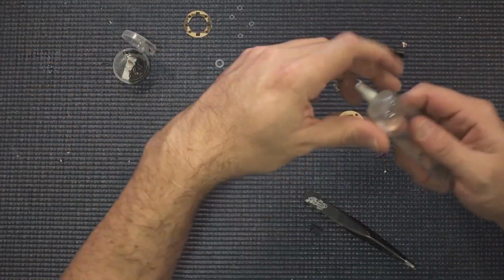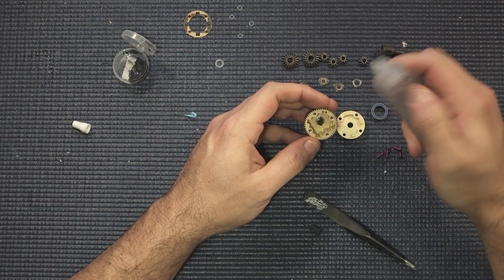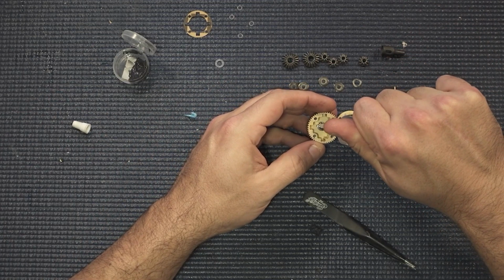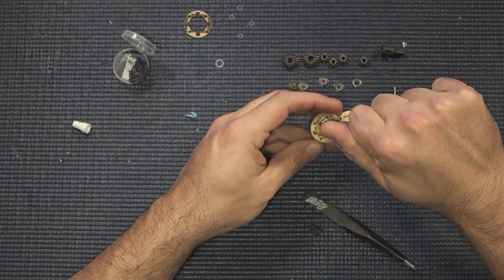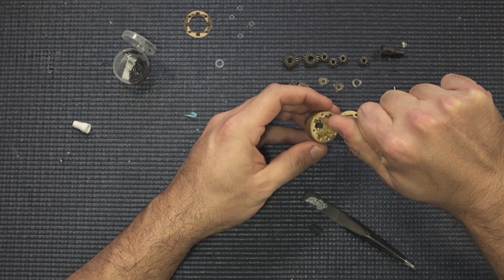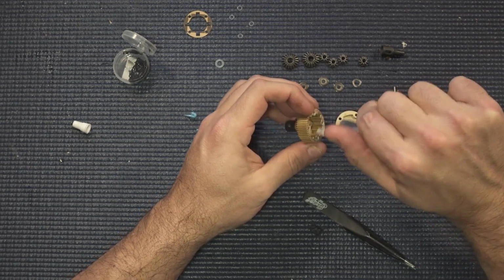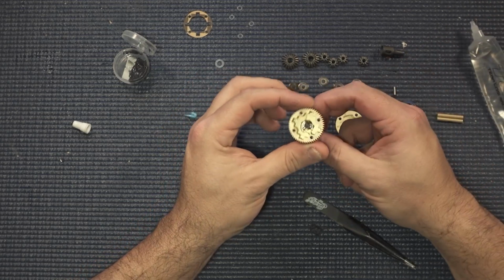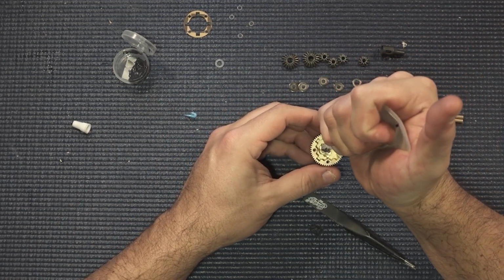And the next thing I want to do is start putting in a little bit of fluid. Just makes things easier, helps things settle down, pack stuff in. You can go ahead and try to work on this and fill it all at the same time. But I just always find it easier to go this route. Plus, it's going to just kind of hold everything in place too. So again, this is 500K. So this stuff is super thick and super difficult to work with. So I'm just going to keep pouring and just kind of turning the diff a little bit. And then once I get a decent amount in there, we'll start spinning it around a little bit and just kind of making sure that everything is in there. And this is just to make sure that we've got fluid where we need it. And you can see that this stuff is just sticking everywhere and not getting hardly anywhere. So again, super thick, probably going to take a lot more than you think.